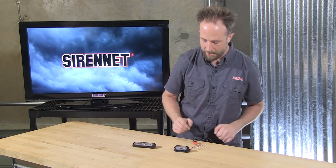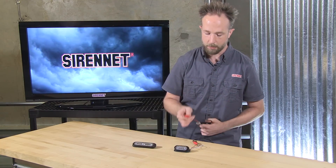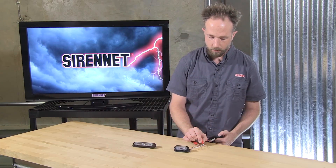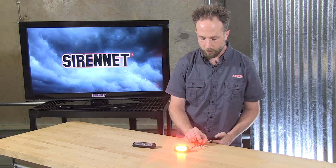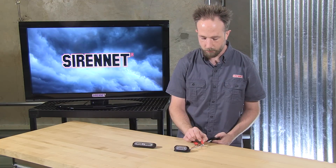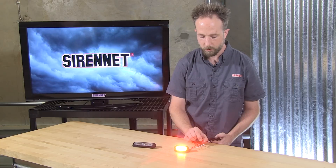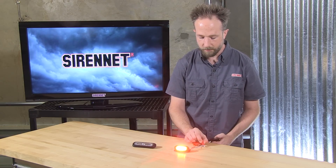So simultaneous or alternating patterns. To make changes, it's the same thing you've used before with Whelan Engineering and their great products — the ScanLock trigger wire, white with violet trace. A momentary tap of a positive 12 volts to that will make a change to the flash patterns. So once you've found something suitable for your application, go ahead and cap that off and tie together the ScanLock.